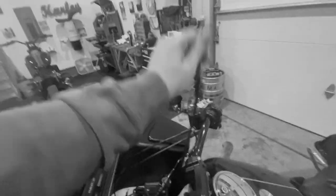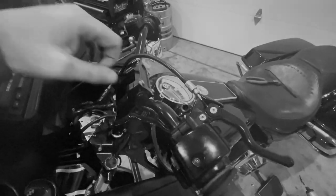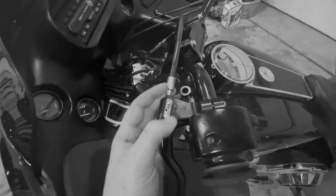I just like to pump it up and down a bunch of times. Then basically reassemble it. Number three Allen — let's put that back on. Just put the eyelet on. Remember, this is flipped right here, so make sure the cable's natural. If the cable's sitting natural right here, then just put it on. Then put this top spacer on. Then the bolt. And now we can adjust the clutch.